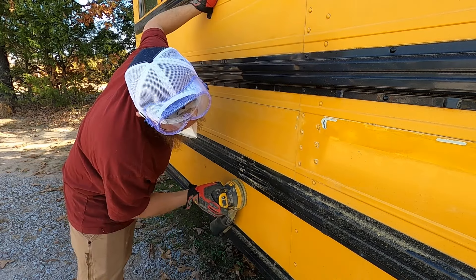This rubber eraser wheel attachment for your drill is a time saver. I wish I would have had this when I was taking the stickers off originally — I didn't, so I just used a scraper. But these things take off the sticker and the adhesive all at the same time, so there's no need to go back and clean up any residue later. They are kind of expensive — this one was $42 from my local auto parts store. There are off-brand ones on Amazon that are cheaper, and while they still work, they just don't last nearly as long as the name brand. I would recommend these to anybody doing anything similar for the simple fact that they save a ton of time and do a really good job.